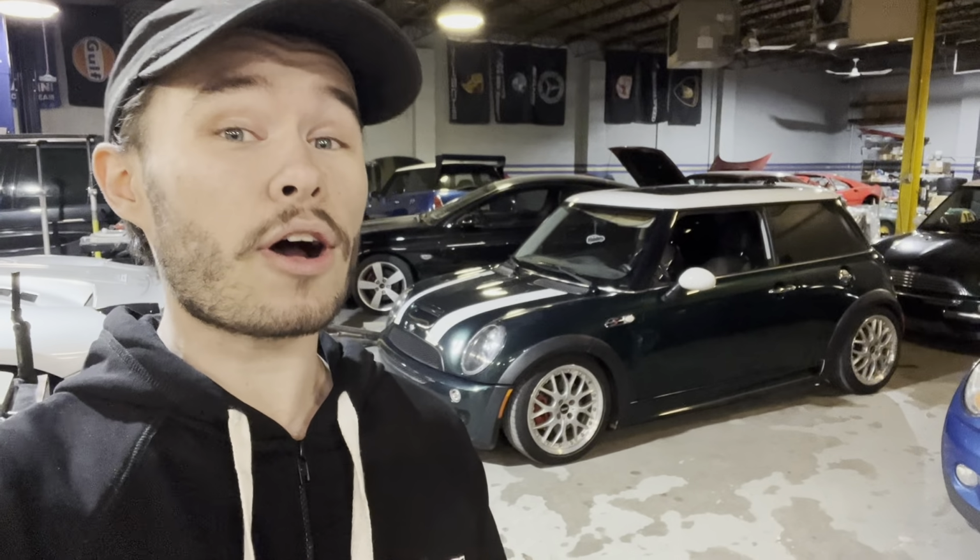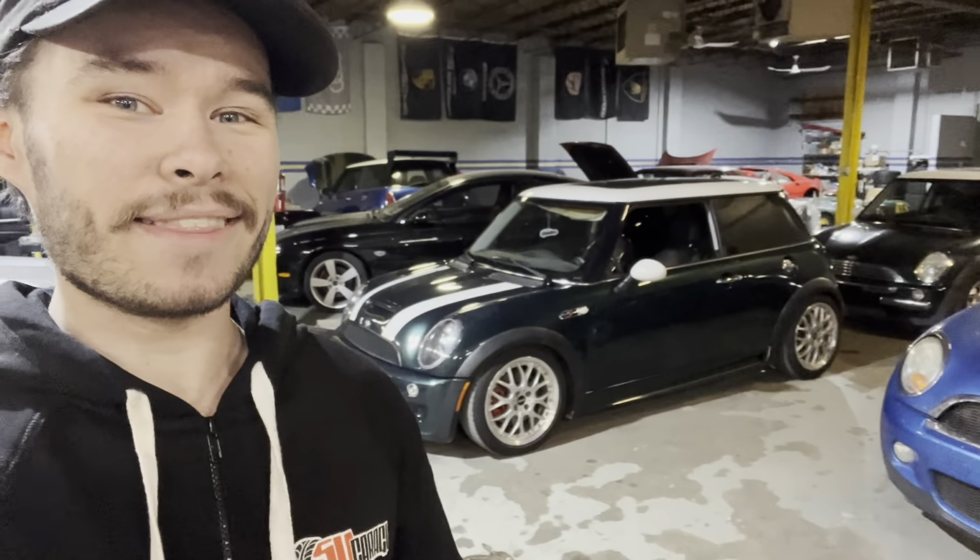I've also verified that the transmission that I pulled out that I thought was good and then thought was bad is actually good, and I verified that by means of installing it in another vehicle that currently runs and drives now with it in it. I'll tell you about that later, but basically what happened was the bolts that I showed you that were the wrong length were the cause of the clutch slipping and the car not going in gear. The transmission was actually good, so chalk that up to a learning experience and measuring twice and cutting once. Everything's all good now. I'm really happy to be driving this car again.